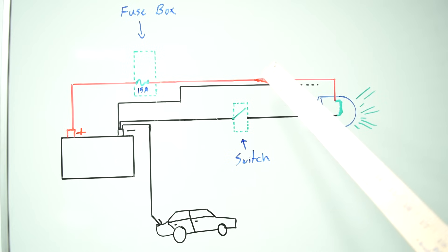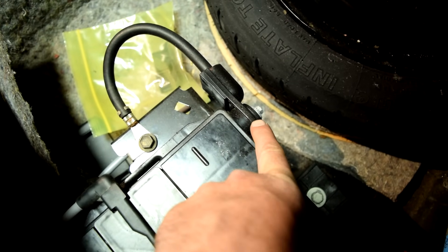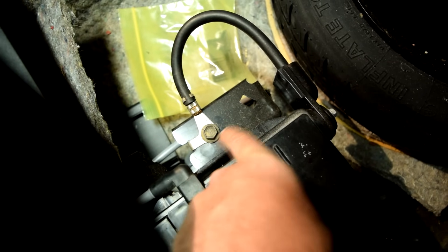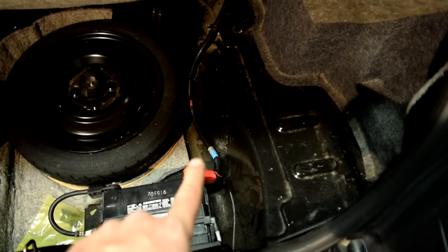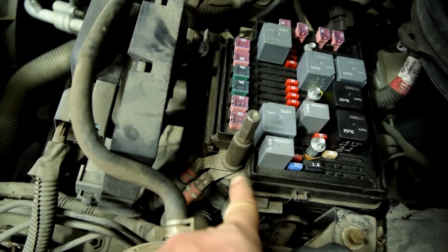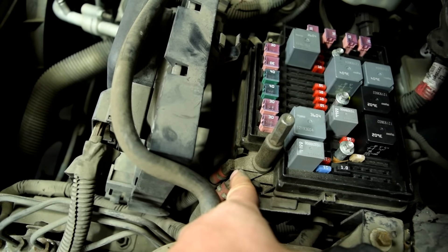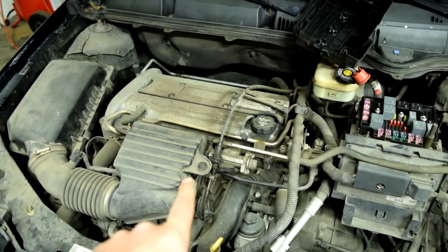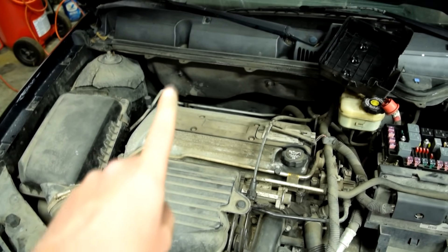So in many cases this hot wire doesn't necessarily have to get damaged and touch another damaged ground wire. It could simply wear out or get damaged and rub against the chassis and get shorted out that way as well. For example, the battery on this car is in the trunk, and if you look close you can see the cable from the negative side is bolted into a bracket which is then bolted to the chassis. On the positive side, this thick cable is run towards the front of the car to a junction box under the hood. The starter is attached to the engine which gets its ground by being connected to the chassis by grounding cables, and the chassis is grounded by that cable in the back.